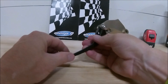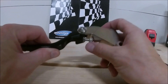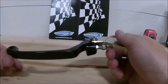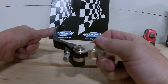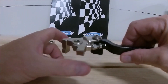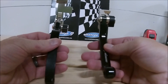I'm really happy with the initial quality on these things. They're a little bit shorter and they offer a lot more adjustability. You've got the regular adjustability of the stock lever, plus this bolt here so you can adjust the pull — how close it sits to the bar. And the cool thing is it flexes the other way quite significantly, so if your bike falls over it's not gonna break your lever off. That's like 90 degrees of flex. The brake lever does the same thing.